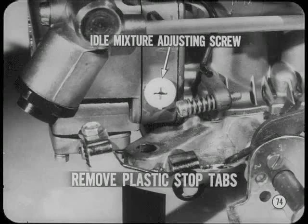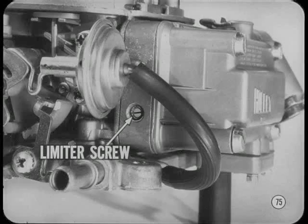This late production Holley carburetor has an idle mixture adjusting screw in each side of the primary metering block. You'll have to check the service manual for the specs, but the procedures and precautions are generally the same as for the AVS model. If you have to reset the idle mixture screws for proper balance, remove the plastic stop tabs. I'm sure most of you know, but if you have to reset the limiter screws on an early production Holley, they're under the plugs on each side of the primary metering block.